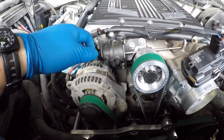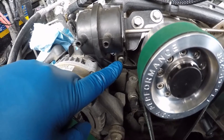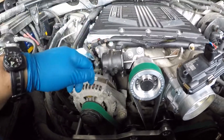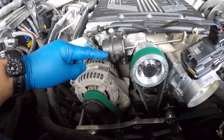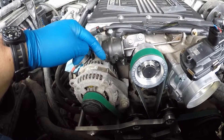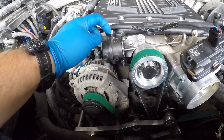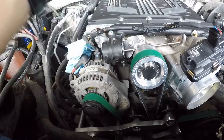For the mechanical way this works: the port down here in the bottom — you have two, one in the back for boost and this one for vacuum — is drawing vacuum directly behind the throttle body. When the throttle plate is closed you have high vacuum, and as you crack the throttle open that vacuum disappears. A vacuum line connects from here to the top port, and as the engine is idling or the throttle is closed, you're drawing vacuum on the top part of this bypass valve actuator. That vacuum overcomes the spring tension and slowly moves the bypass blade open, allowing boost pressure to escape.